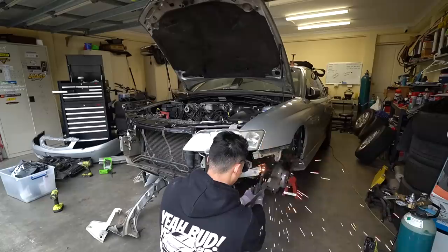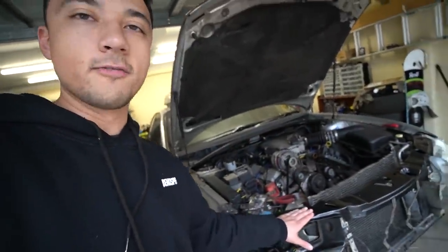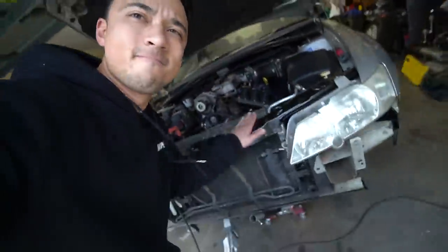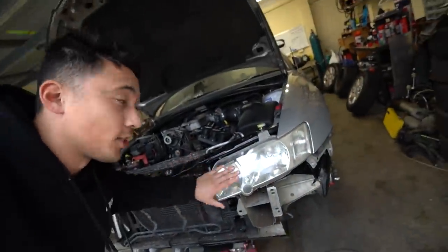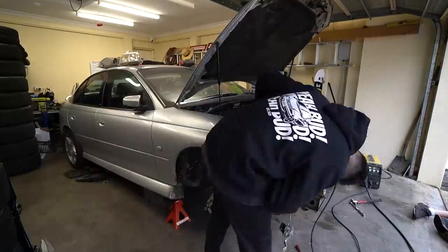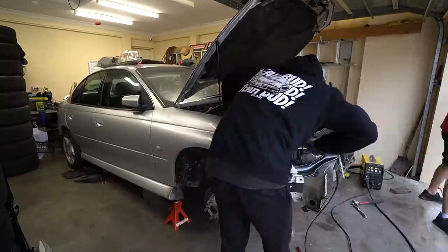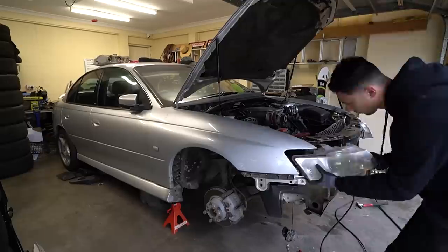This was a very timely process and the footage was filmed over many hours. We've been going ahead tacking everything on and it's basically all done on this side — it is solid as hell. The headlight matches the fender, all the body lines are nice when I close the hood. We just need to chuck the fender on the other side and the headlight to make sure everything's lined up before tacking on that side as well. Surprisingly, the driver's side lined up just as well as the passenger side.